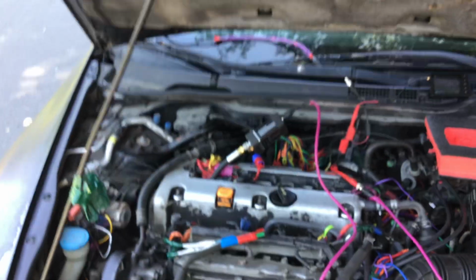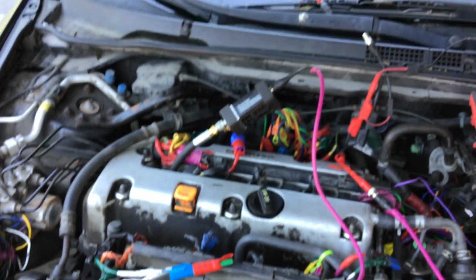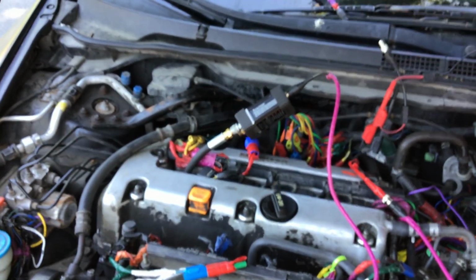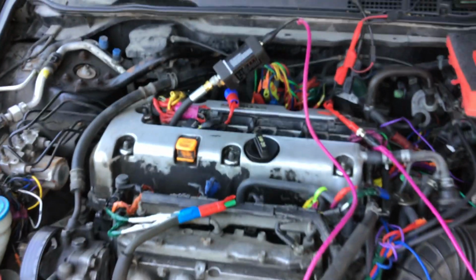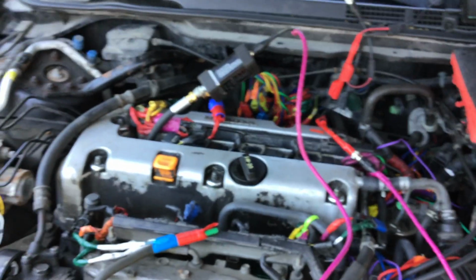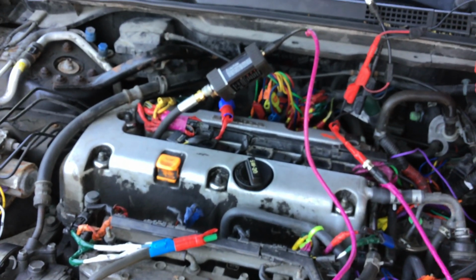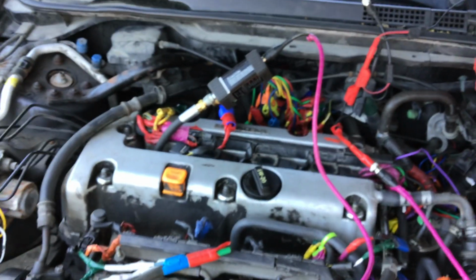So anyway, I have the transducer in cylinder 1 to determine TDC. I will move that transducer, and I would change the setting to a range 3. I'm on range 1 now. I'm using the Uscope, as you can see right here. I will then move that transducer to the intake manifold. Then I will put another compression hose into cylinder 1, and I will blow air into that. I'll pulse air from a hand pump into the cylinder to see if that cylinder in fact is leaking at top dead center, to determine if there could be compromise of the intake or exhaust valves. I do have a transducer in the tailpipe also.